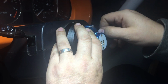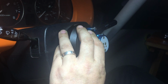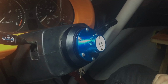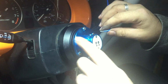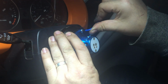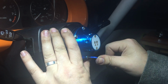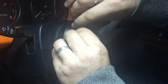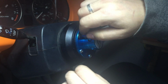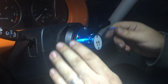This is held in place with some 4mm Allen head bolts that are provided with the kit. With the back part of the boss in place and the screws put in finger tight, I'm going to snug this up, tightening everything diagonally or opposites. So I'm going to go 12 o'clock, 6 o'clock, whatever o'clock that is, 10 o'clock-ish, about 3:30.